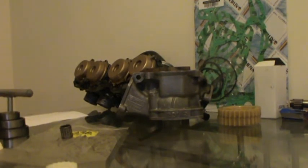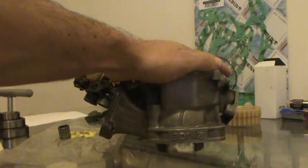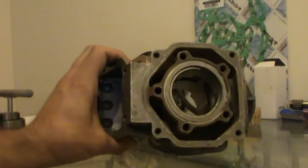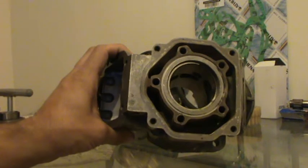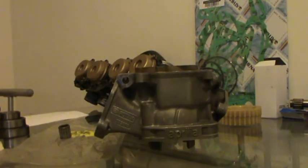After £165.78, what I need to do is send this away to get the barrel re-nikasil sealed. I will try and get the 54mm diameter so I can buy a possible £98-£99 piston - get it fairly tight but just right. That's going to be about £160, and it's going to be from Lang Court - L-A-N-G-C-O-U-R-T dot co dot uk. That company will re-nikasil seal your barrels. They can either weld the inside where it's been damaged then re-nikasil seal it, or if it's in serviceable order, they'll just bore it out and re-nikasil seal it to the right dimensions, diamond it up so it's nice and tight, and send it back for the best part of £160, not including delivery.